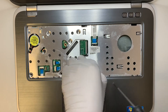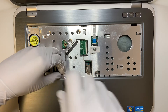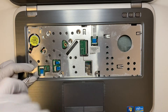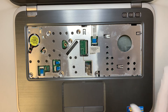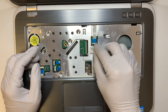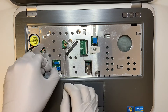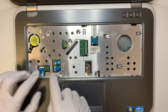There are four screws that hold on to the palm rest, or you can call it the touch pad area — this whole thing. Go ahead and remove the four screws. You also want to disconnect the ribbon cable, so flip open the clip. There are four of them.